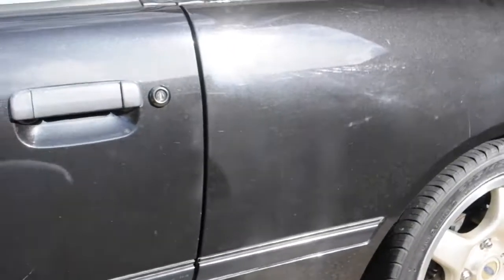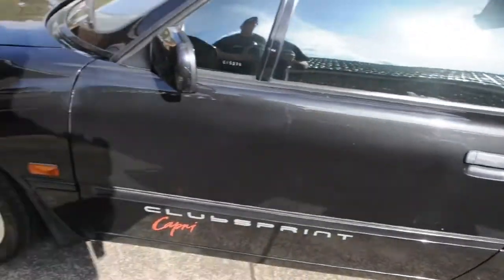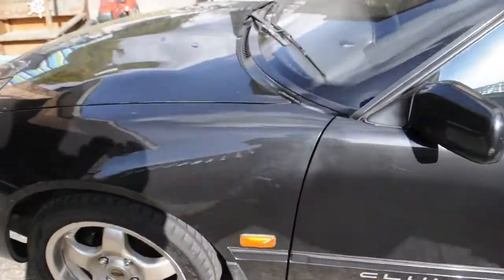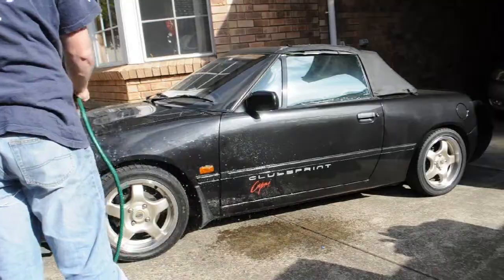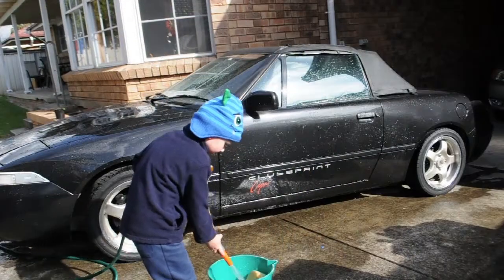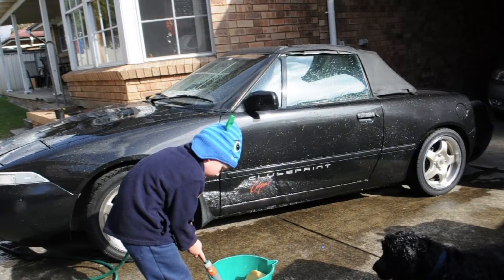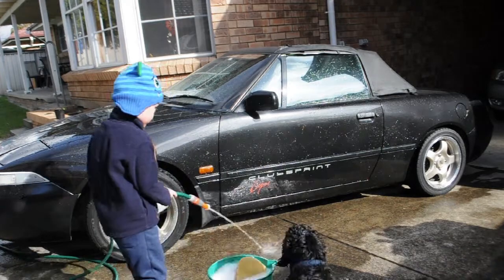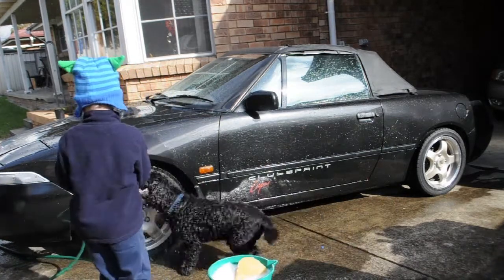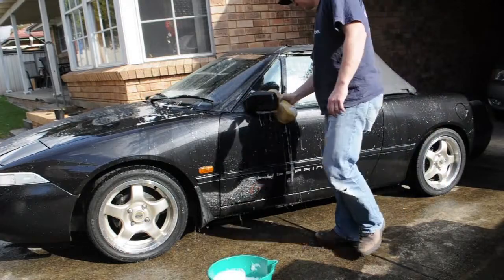As you can see, I've had a really good go at cleaning this car, and I have had a go at the clay bar before, but these are the areas that I haven't done yet, or that I missed the first time. You can see it looks like there's a haze or there's something over the paint. You can see these patches just in the crease between the doors that I've missed. So first things first, you've got to make sure your car's clean. If you don't do this, your clay bar will end up picking up every piece of dirt on your car, which means it's going to fill up really quickly and it's not going to be effective.